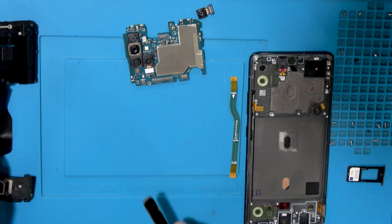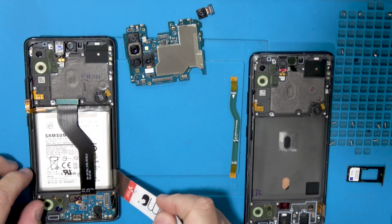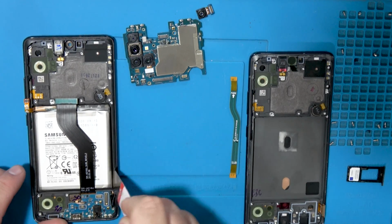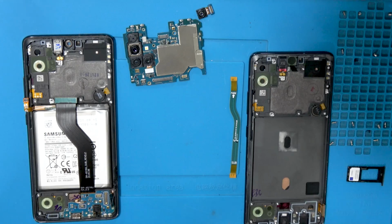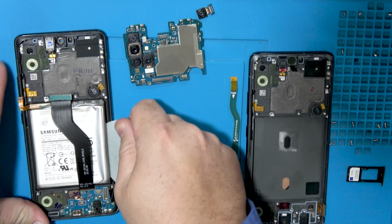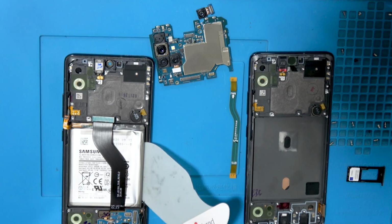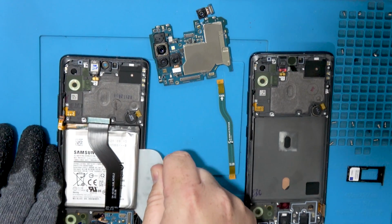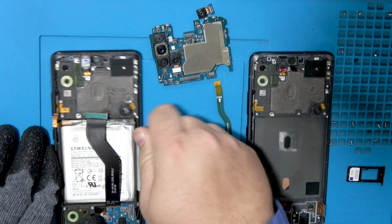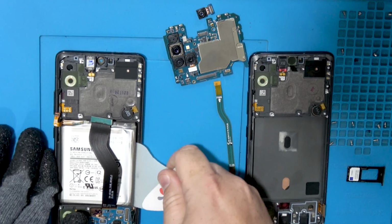Okay, now that our battery is hot to touch, we're gonna go ahead and move that over. And yeah, it literally is. Just slowly move your tool here. It does bend a little bit because these are permanently glued down. You're gonna take your iPlastix tool, and that's gonna actually help you get underneath that battery without bending it too much. I wear my gloves because I'm burning myself because this blasted battery doesn't want to come out. Yeesh, this is some really strong glue.